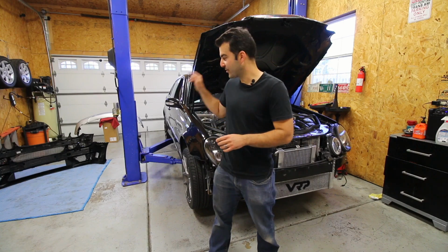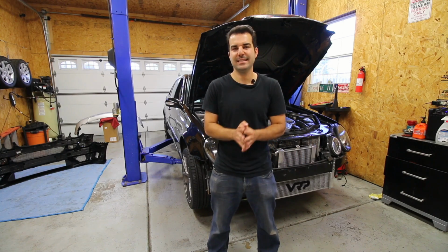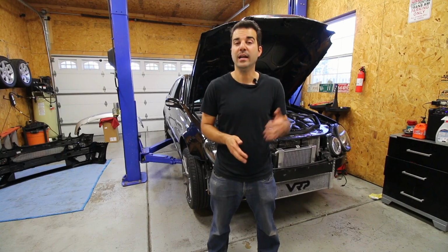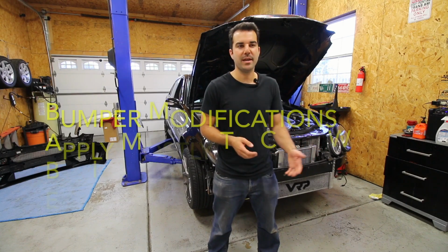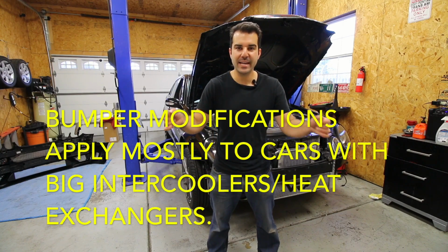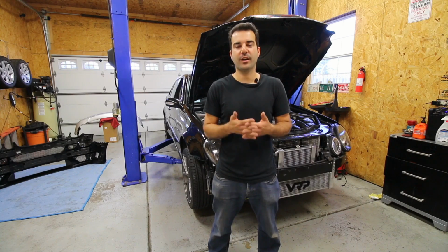All right, before we get to installing the E63 bumper on the E55, I have 3 quick tips on buying bumpers and body parts in general, and I'm going to try and do this in less than 1 minute. First tip, do not send out anything for paint before test fitting it on your car. Sometimes aftermarket bumpers and body panels require adjustments, elongating holes and whatnot, and you don't want to manhandle a freshly painted part a million times putting it on and off the car.